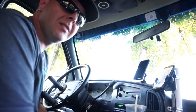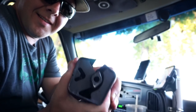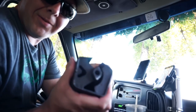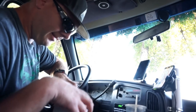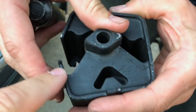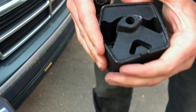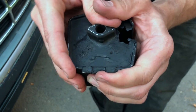So I'm sitting here in the parking lot at the parts store and I just got the motor mount. I can tell you why it broke — they're extremely crappy. My grip strength is fair to middling, but look, I can squeeze it with my hands. No wonder the stupid thing broke — that's absolutely insane. The other side, you can poke your finger through the material like it's not even connected. We may have to modify this before we install it because that is borderline unacceptable. Squeeze it by hand and the rubber's cracking. Now it's old. Wrecked.